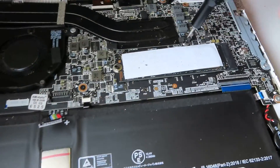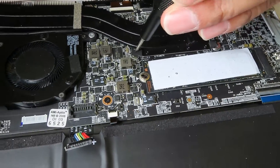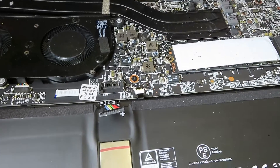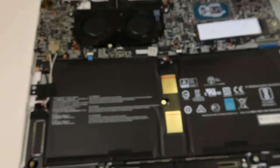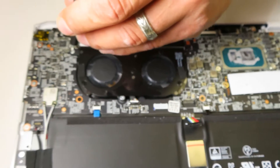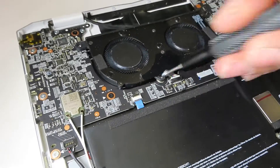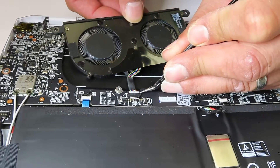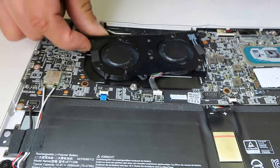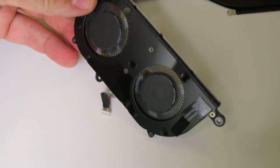Now I'll be removing the heat sink. There are three screws on the actual heat sink and a few more for the cooling fans. The heat sink is completely bent, so even if I try to reuse it, it's probably not going to do as good a job — best idea would be to order a brand new one. Same story with the cooling fans: even though the motors are working fine, the actual metal plates are bent. As you can see, it's curved as well. This is the 512 gig SSD — if you need to upgrade or replace it, there is only one screw holding it on the motherboard. Make sure you choose a compatible M.2 SSD drive, otherwise it might not work on this laptop.